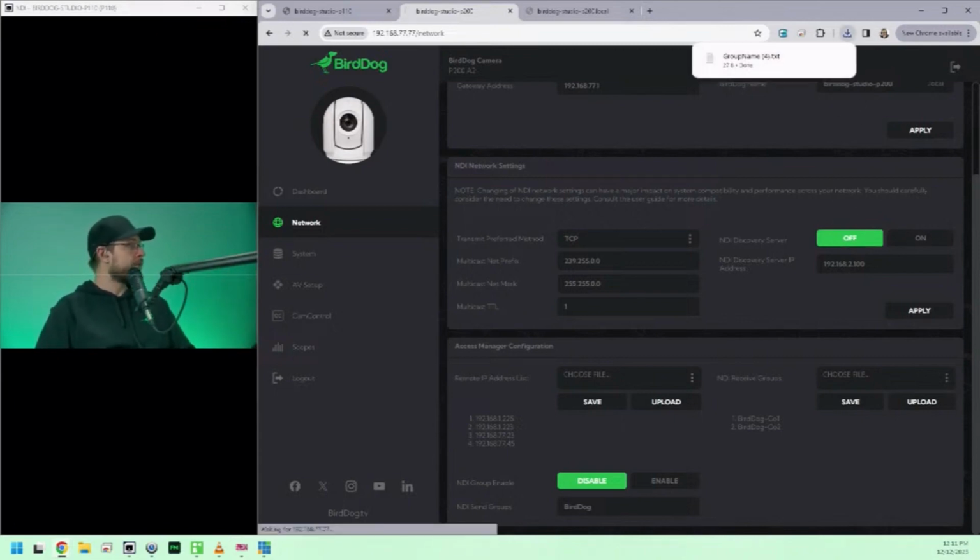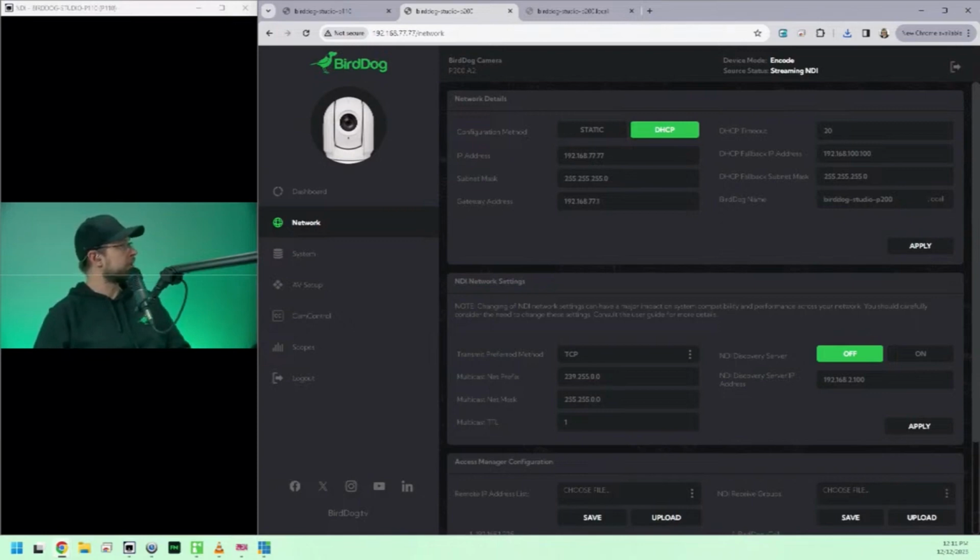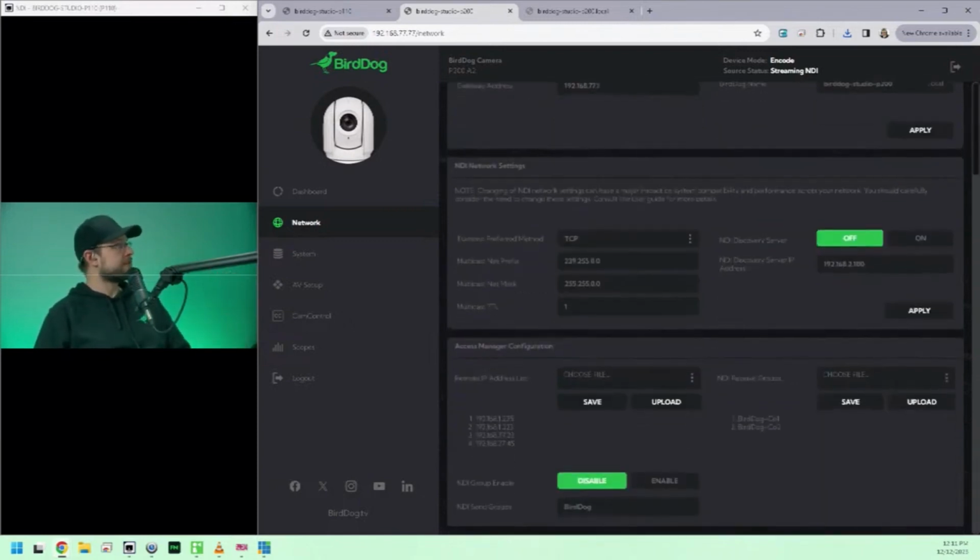Same thing here. If you want to add NDI receive groups, okay, so if you're operating in a single flat subnet, but you want to separate things kind of in like soft boxes, you can do that with groups. And I have a video on NDI groups on our channel, so please check that out. But we can use groups, same rule applies.